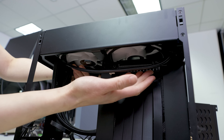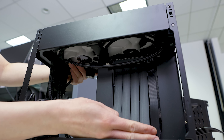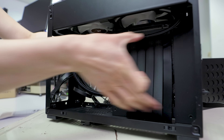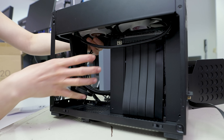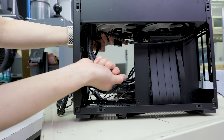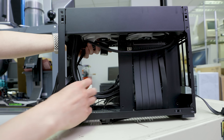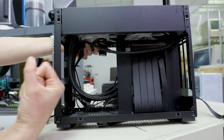Then you have all this space, in theory, for the graphics card. But the power supply will take up some room, and not just because it's there — it will also push cables and, in my case, the tubes from my AIO cooler further in this direction. So you'll have power supply cables to deal with as well. Keep these things in mind when choosing your parts.